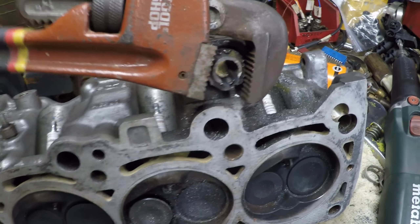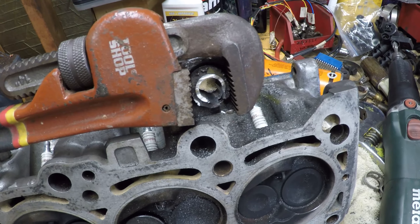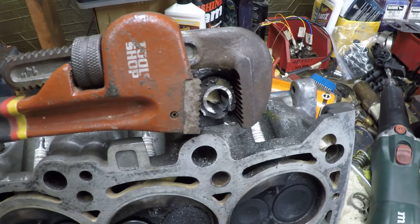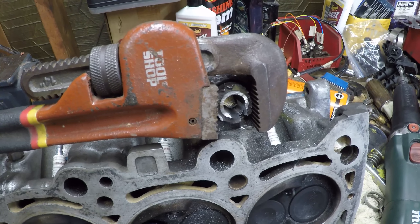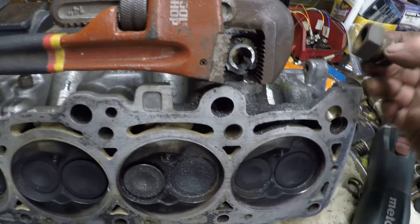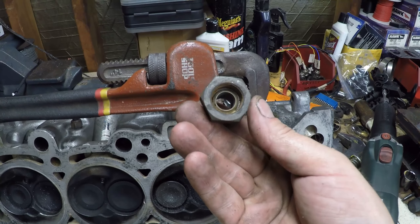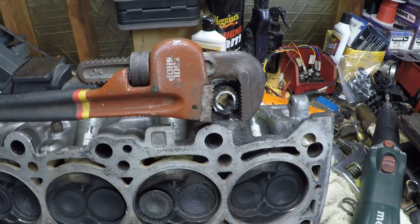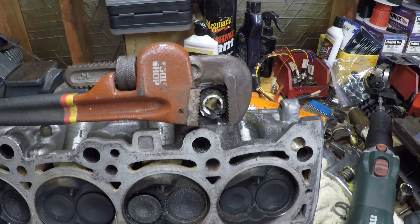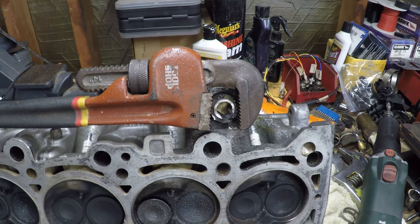If you go slow and use that cold chisel, you can get it to where the fitting will come loose. You can barely, barely touch it to where you can just start to see the slightest hint of the threads in there, and it broke loose. Highly recommended — this old-style fitting. I actually have a different one on the bench. This is the later-style fitting that came in them; these reliably come out in my experience. The one that was in there had a very thin flange to put a wrench on. This is how pretty much all of them end. But we're going to be going to some AN lines on this instead. I've just got to get this head cleaned up really well after all this.